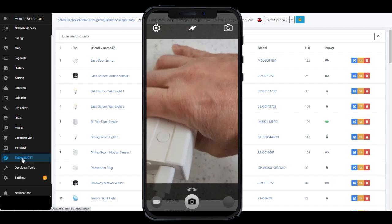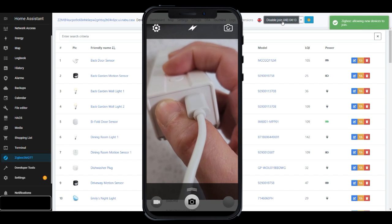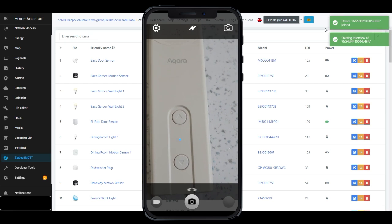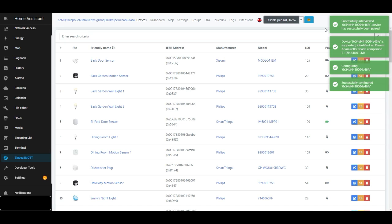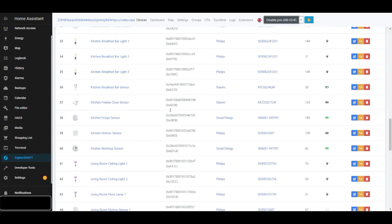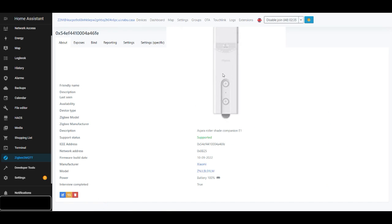The first thing I'm going to do is get the driver set up in Home Assistant. To put the device in pairing mode, press the reset button on the bottom for five seconds, and also put the MQTT integration into pairing mode in Home Assistant. The light was flashing, and you can see Home Assistant has detected the Zigbee device, interviewed it, and is integrating it. Scroll to the bottom of the device list in MQTT and you'll see a new device with an alphanumeric name.